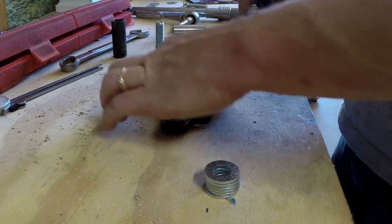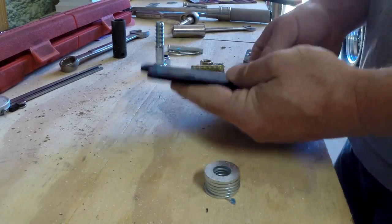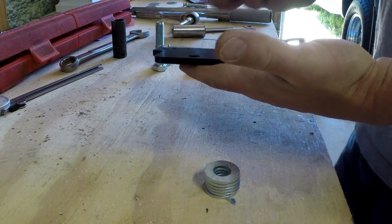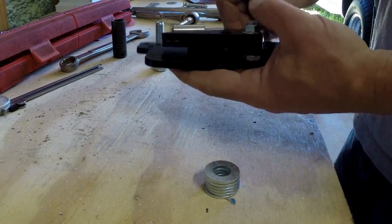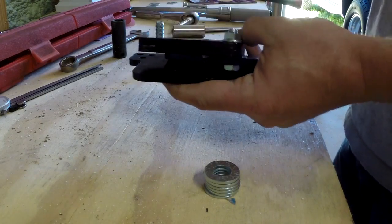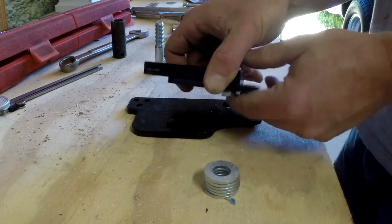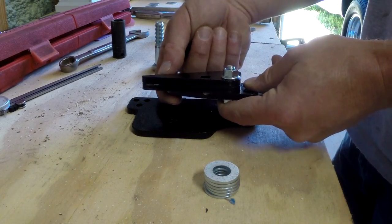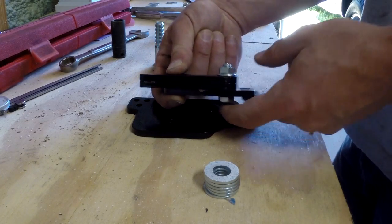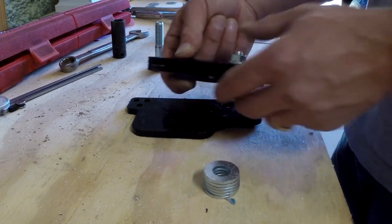You have to align this on the spring — this bolts to the bottom of the spring and the wedge turns under the spring. It goes between — on top of the spring — so this wedge goes under the main leaf springs but over the overload spring on the bottom. It wedges in between those, so automatically when you put a load on, those lower springs start working instead of having to fill the gap first.